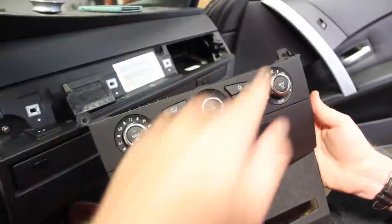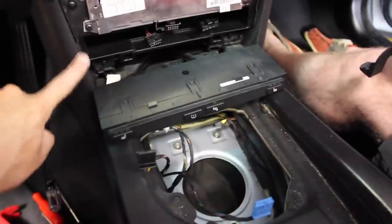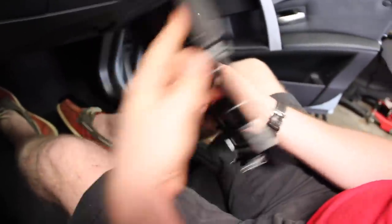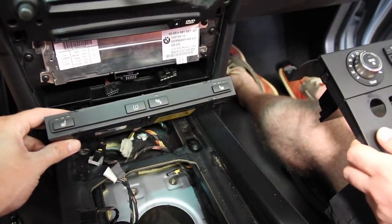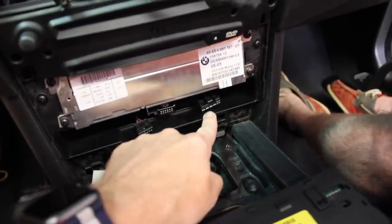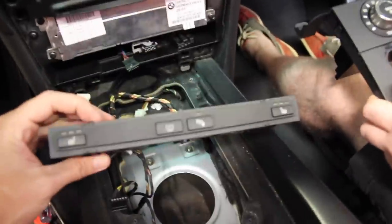Once we remove those two Phillips screws, use a plastic non-marring pry tool to pry outwards at each side. The back is held onto the dashboard with four clips. That comes off, and we're greeted with the SZM panel, which isn't really held in with anything — just sitting there, plugged in with three electrical connectors. One pulls out, one has a little lock lever, and the third has a tab you depress. Take this out — we'll be putting in a different one. We'll need to make some pinning changes here.